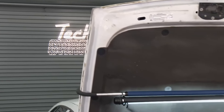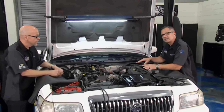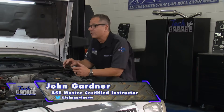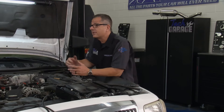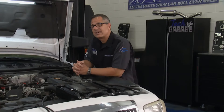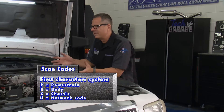Welcome back to Tech Garage, presented by rockauto.com. We've got Project M&M back into the shop addressing another code. On our prior episode we looked at P0300, which was a misfire. We got all new coils on here. The coils and spark plugs - we're in good shape, and it idled smooth. You took it on a test drive - how'd it drive? It ran real smooth, like a V8 should - lots of power and no hesitation. Now we need to address that second code: P0442, a small evaporative emissions leak.